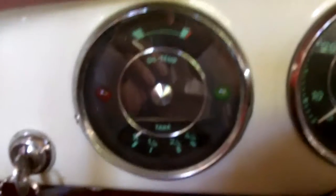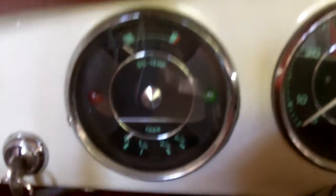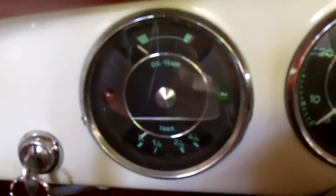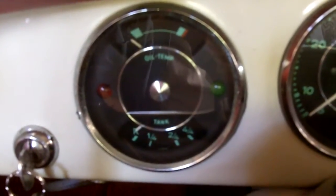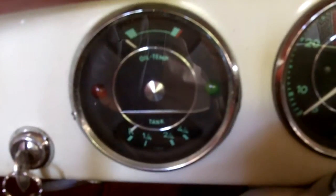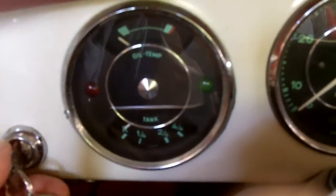Let's warm up the engine and take a look at it in action. The engine in this car is a freshly overhauled B engine, so it has the tall oil pump gears. Even so, you can't maintain 28 psi at slow idle with warm oil, so we're going to see a blinking light at least at slow idle.